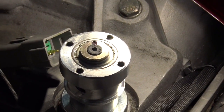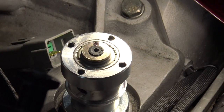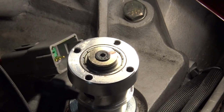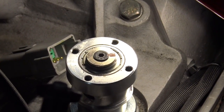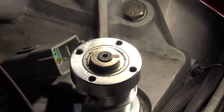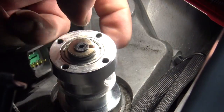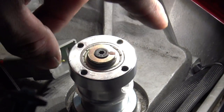There's 195 on the exhaust stroke. I'm going to go 360 degrees on the crankshaft, and that's going to move 180 degrees back there. There's 195 on the compression stroke. The body of this spun a little bit because it ain't clamped down. But what you do is you line up your opening, and you'll see that your magnet is back here, lined up with that dot. Clamp it down, and you're done.